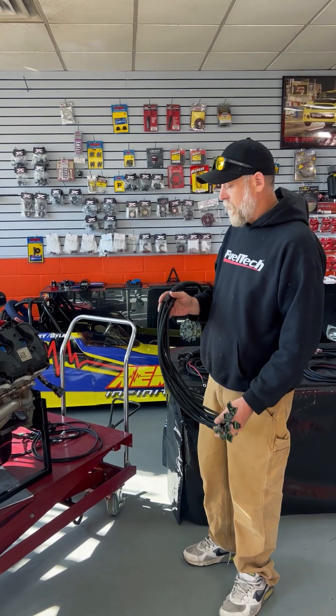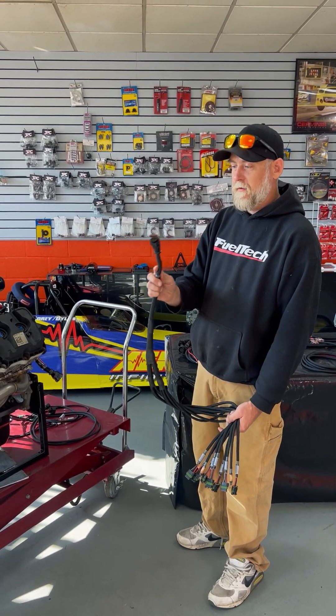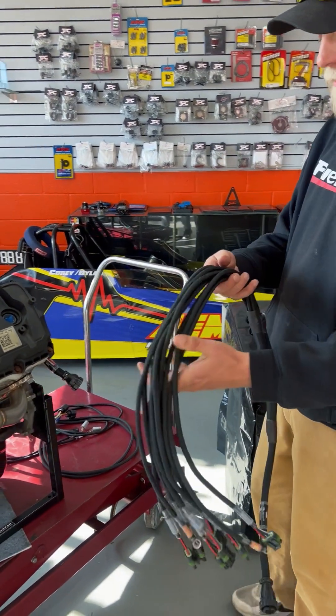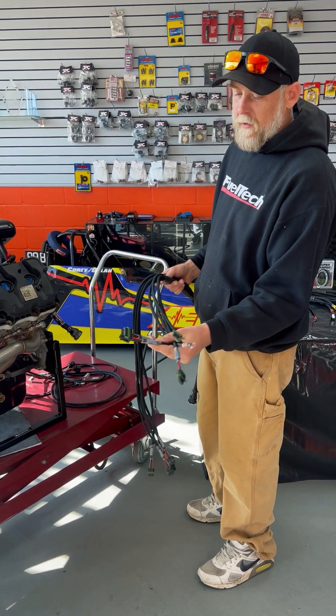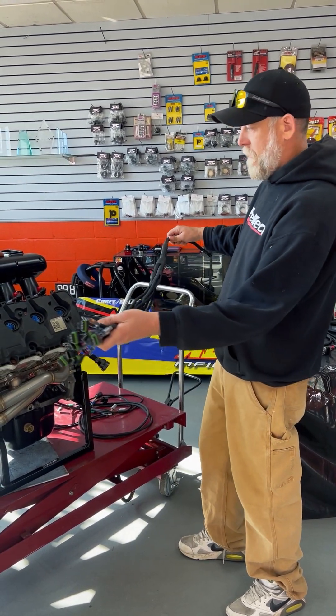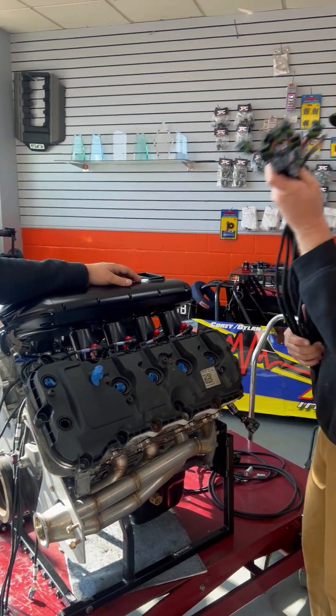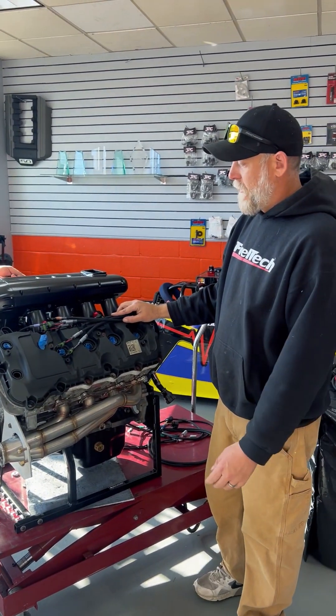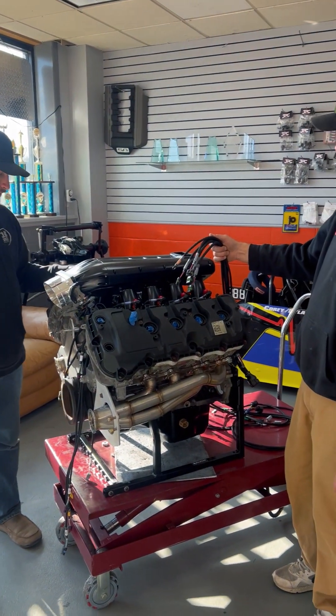The last thing we wanted to touch on is the smart coil harness engine section. You've got your bulkhead connector here that connects into your smart coil harness — same principle as before, all labeled cylinder one through four for each bank, with the cylinder head ground exactly as they want you to run it. It's long, but you get one braid for each end of the engine, tie it up, and you can be up and running on smart coils in no time. Hopefully that answers a lot of questions about what the pro harness is and if it'll work for a coyote. If you have any questions, put them in the comments.